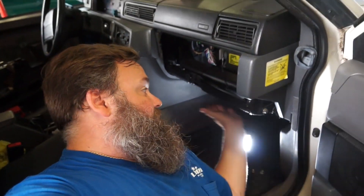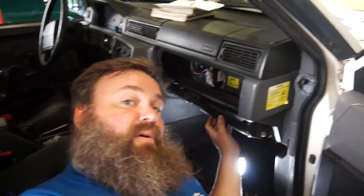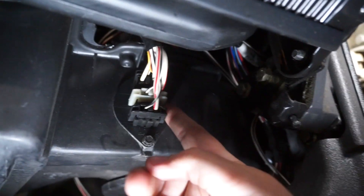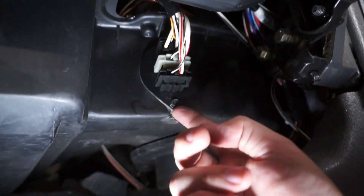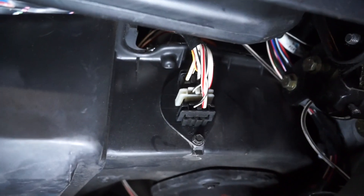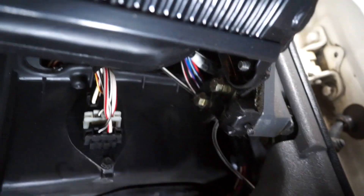Now that we've got the glove box out and the under panel off, you can remove this knee brace if you absolutely have to, but on a '94 940 you shouldn't have to. It's actually a pretty simple, easy process to get to. This guy right here is your blower motor resistor — pretty simple to get to, no big deal. It's just held in here with two bolts and slides right back out. Easy peasy. We've got to take these two bolts off, which should be about an 8-millimeter, and then disconnect the wiring harness from this guy. In my case, it's a 7-millimeter bolt that holds that blower motor resistor in.